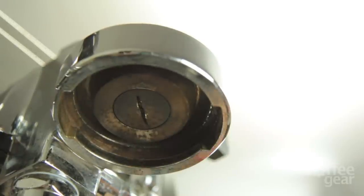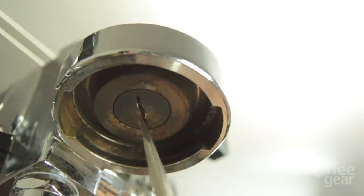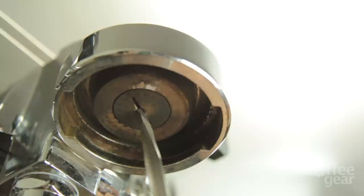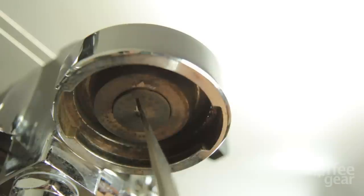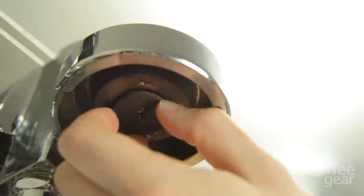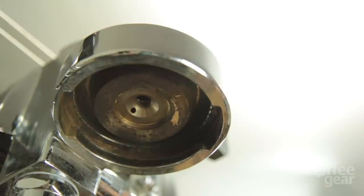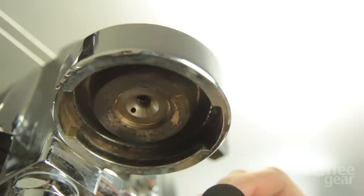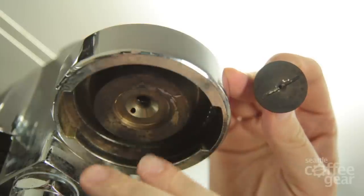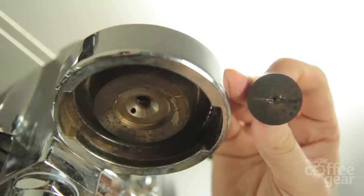Now that the screen is out, we can see our diffuser right here in the middle — it looks like it's been removed before. You can see the soft brass is exposed there. I'm going to put this screwdriver right in the middle and go counterclockwise, lefty-loosey, and the diffuser starts to come free. There aren't too many threads, so I'll do the rest by hand. This is very dirty — it should be brass and shiny. This isn't part of the tune-up kit, but we sell them on our website. You shouldn't need to replace this very often. What you'll want to do is soak it in very hot water or Cafiza to clean off all the coffee residue buildup.